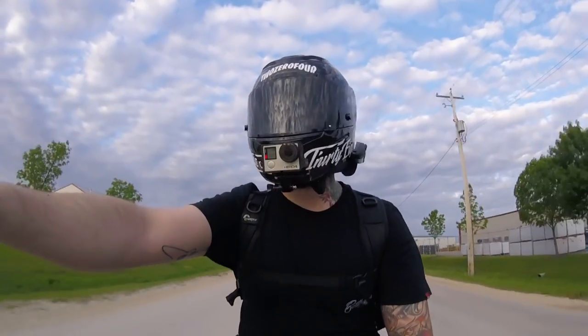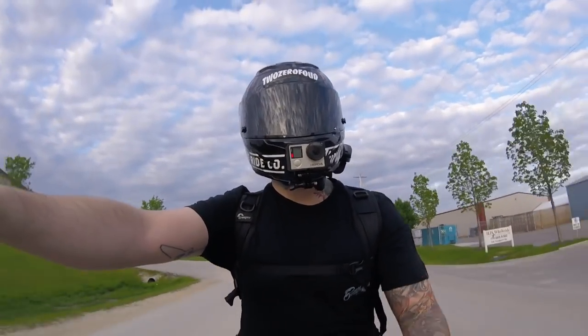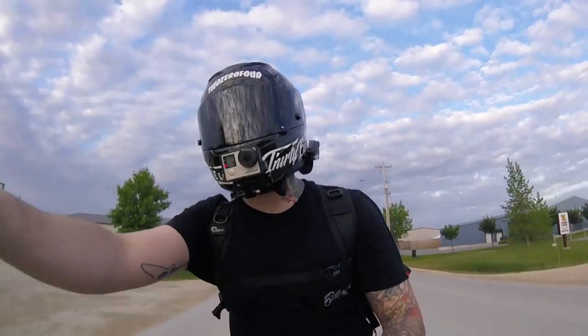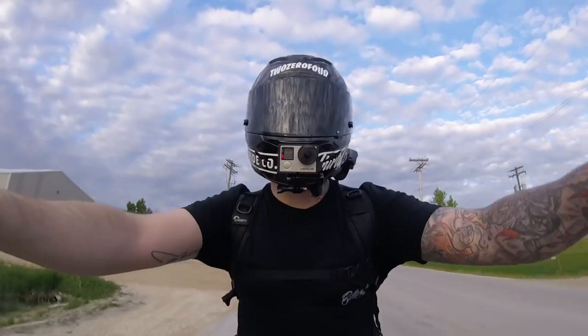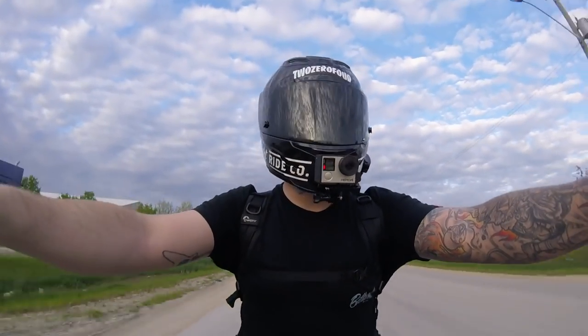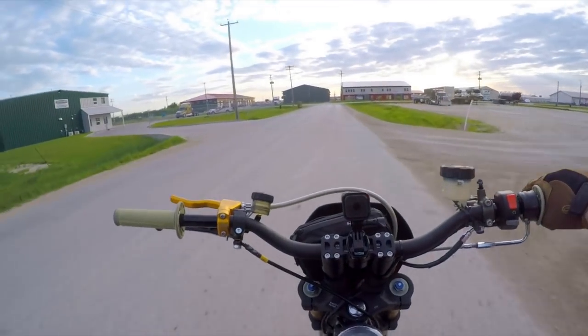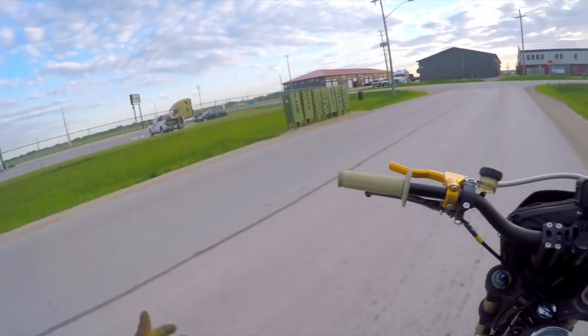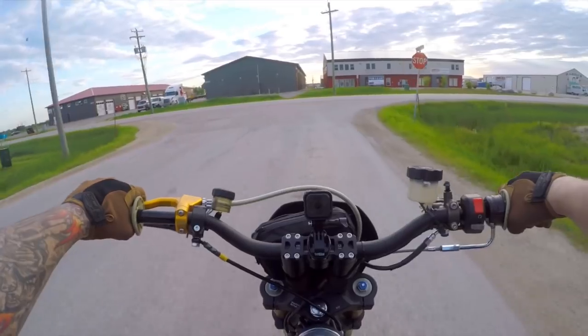I did crank up the spring preload full bat just because I wanted the ride height, but I haven't touched compression rebound at all yet, so it sounds like that's something I'm gonna have to dick around with the next few days. And I have to dial in these brand new rear shocks too. Totally slipped my mind on that also. I've had so many things on the go with this bike that I forgot a bunch of stuff.